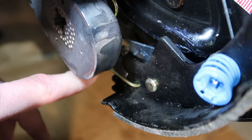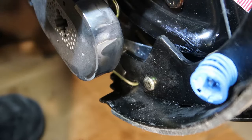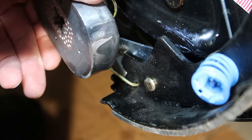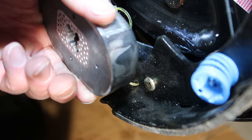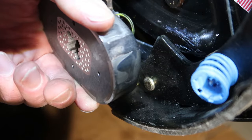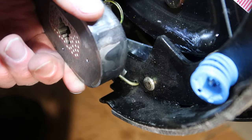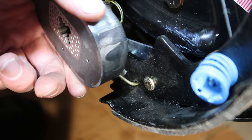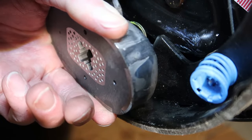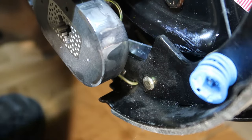When the brakes release, it causes that adjuster wheel to spin one notch. We'll move this magnet — the magnet attaches itself to the interior surface of the wheel hub drum, moves in this direction, and you can see that arm is moving up. You hear that click — it just engaged itself on the next tooth. As we let the brakes off, it adjusts itself and moves the equivalent of one tooth rotation. If we do it again, it just clicked — there we have one more rotation.